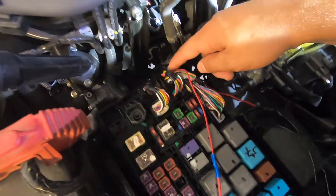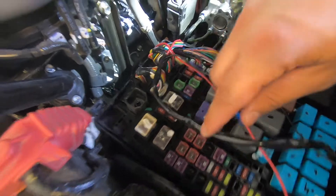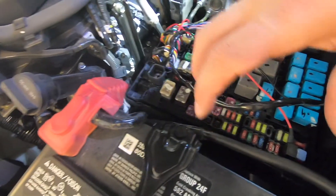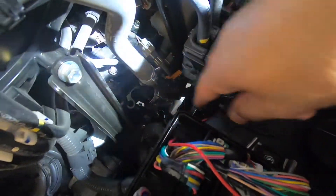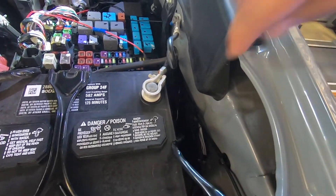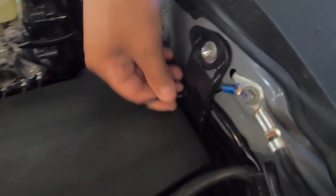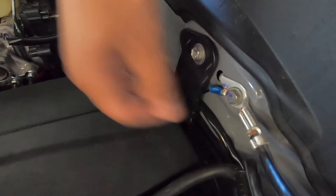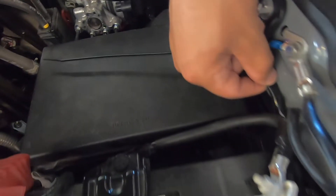With the way we ran the wires back there, no wires are getting pinched. Here's the Raptor lights running through the back. If you don't go through the back and just leave everything up top, your lights are going to have to come outward from the fuse box, and when you put the top back on it's going to pinch the wires. Running it back here leaves it clean. My Raptor lights are even going back behind the mount that holds the fuse box. Just to clean it up even more, we added a zip tie right here which is going to hold the Raptor lights and keep just enough tension — that way it's not all loose and it'll stay secured.